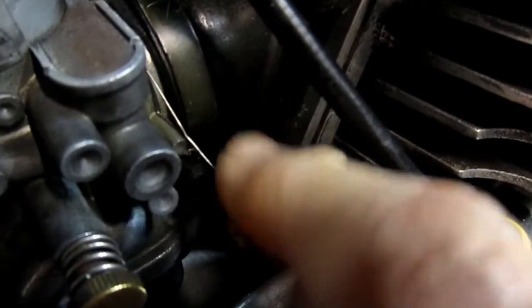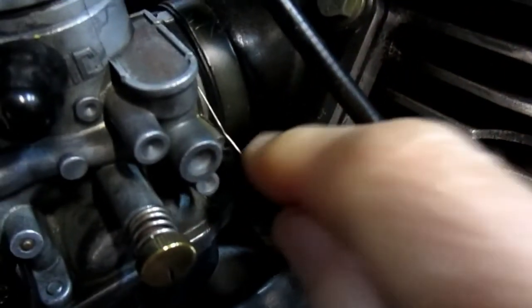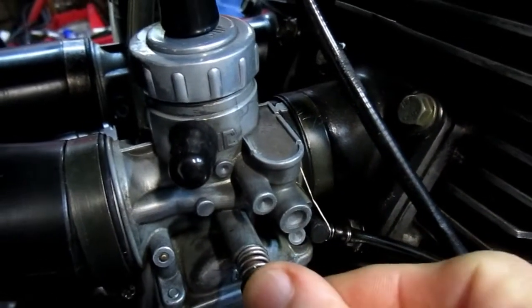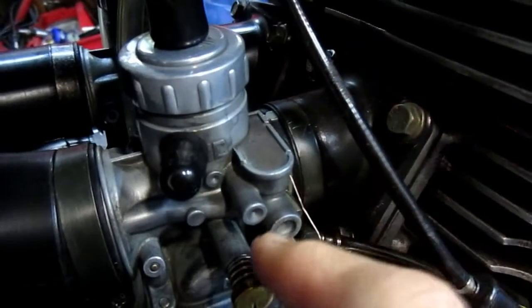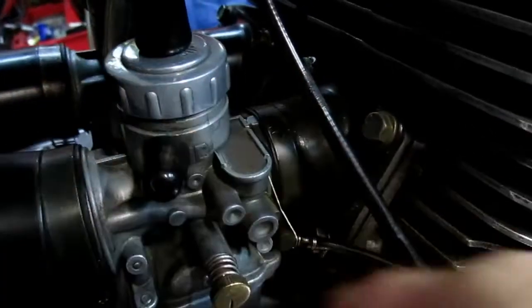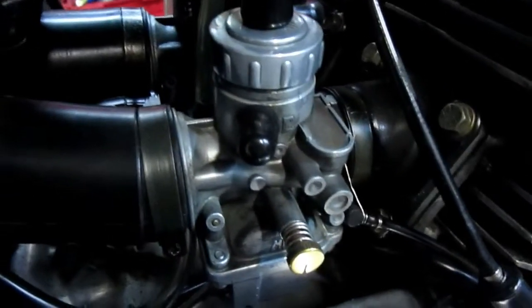A couple other little tips that I include. I always safety wire my oil lines in place, but this has to be a press fit. This can't be a sloppy fit. So drilling that hole is going to be critical, and I'll spend a lot of time figuring and getting that just right. The other thing is, because the stock carburetors are mirror images, in other words, this adjustment screw is on the other side, on the other carburetor, very convenient. This may be, with the new replacement carbs, a little less convenient. I'll have a choke on this side, and I'll also have this on the other side of the carburetor. I'm going to have to figure if I can get in there with a screwdriver or adjust it by hand, and it's something that has to be done from time to time, well, with any two-stroke.